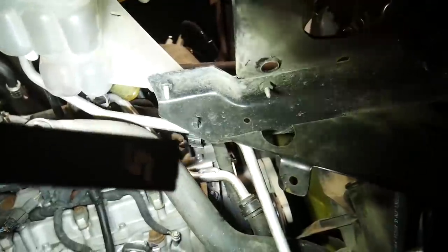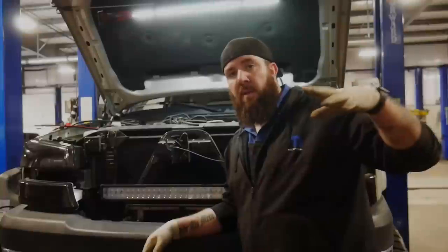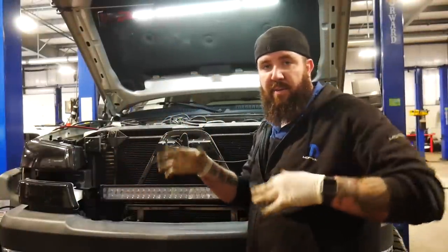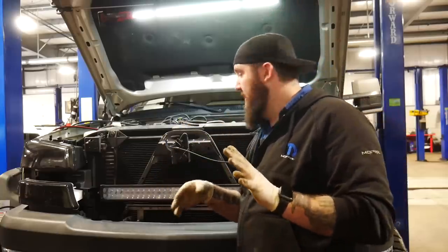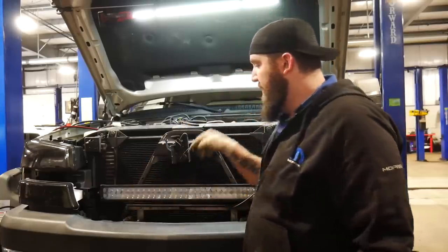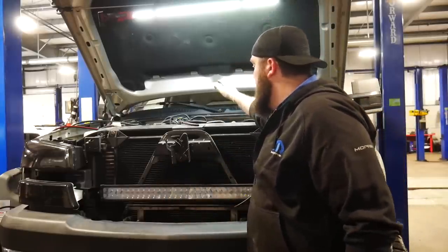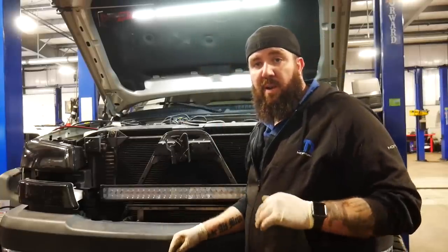There's one hose right here on the bottom of the coolant reservoir — you'll want to make sure you take that off as well. So we've got the top cover off and pulled the grill out. I'm not going to go through every single little bit on this; if you guys haven't had those parts out before, I'm sure there's a million videos on that. We've got our trans cooler lines here that we need to get off as well. Pull those down through, and then we'll start getting our AC lines off our compressor — one will come this way, the other one will kind of fold up into the cowl up there.